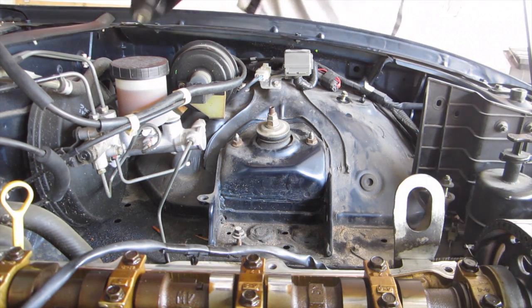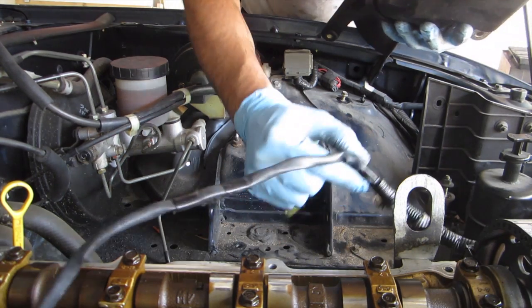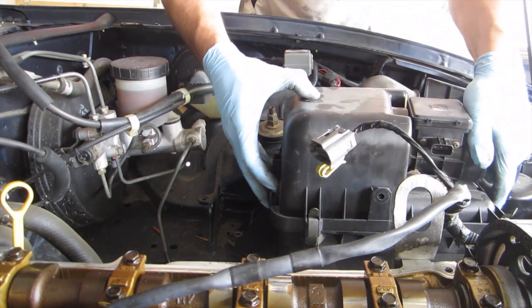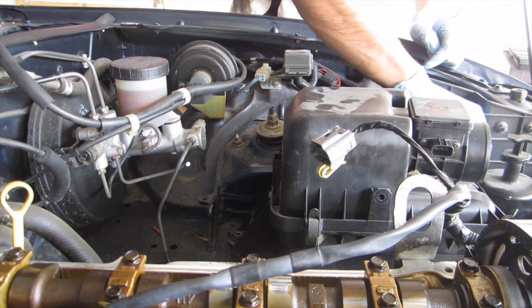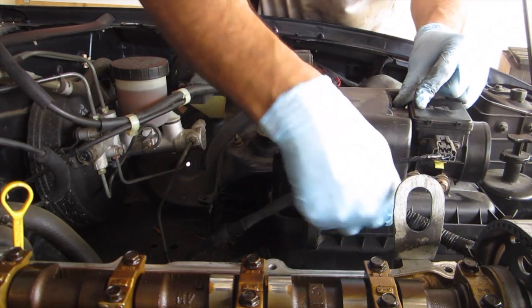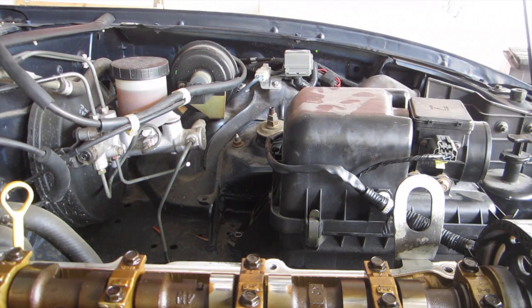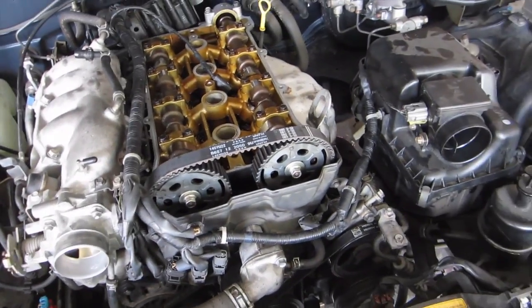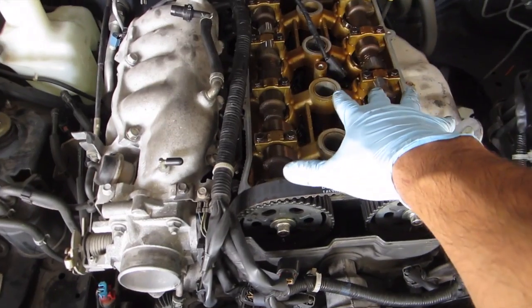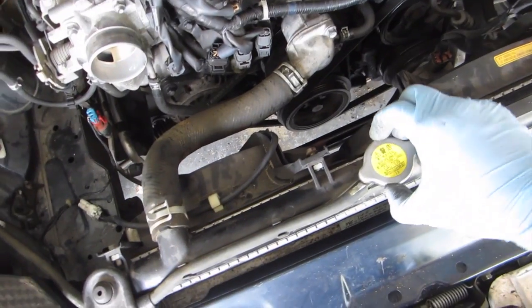After that, of course, you just put in the air box. Make sure the wiring's out of the way. Anyway, you get the idea. And then just snap in your electrical connections. And then from here, just put in the crossover tube. Make sure you got all the other connections done. And after that, I was going to do something special with the valve cover. Once you put the valve cover in, go with the ignition coils, put your plugs and wires back on, and then we'll begin burping the radiator.